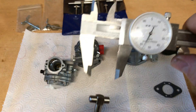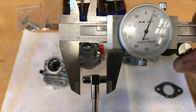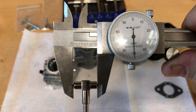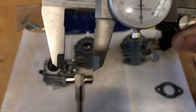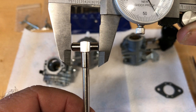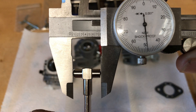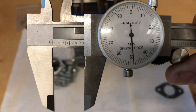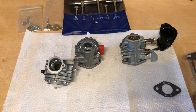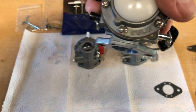I'm probably going to be off a thousandth or two, maybe more, so this is just going to be a rough estimate — I can't get exact because of the flashing. This is the Fulin brand carburetor, and as it turns out it's got a venturi size of right at 750 thousandths — you're looking at right at three quarters of an inch. That's perfectly respectable; that would be a good improvement over a stock 212 carburetor. Just the little Fulin — F-U-L-I-N brand — and that was the first one I received.